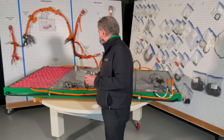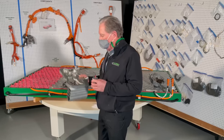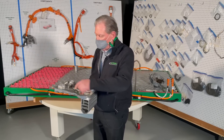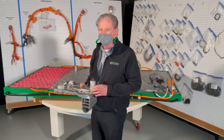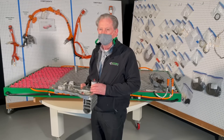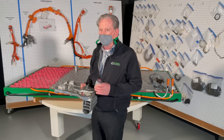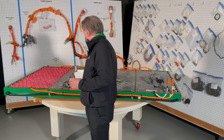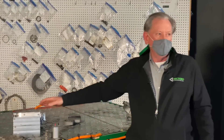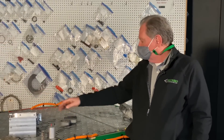The heat is all down at the bottom and I want to pull it out using some sort of manifold. I plunk the manifold on top, there's coolant going around underneath in some sort of path, and that path will wick away the heat from the battery in an efficient and effective way. One approach is this welded plate design.